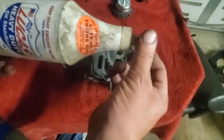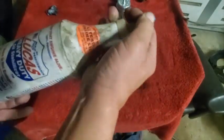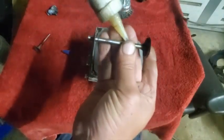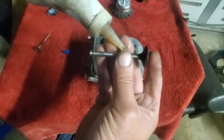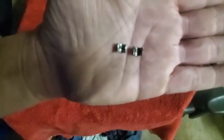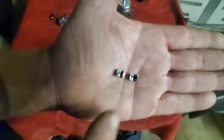I'll be putting the valves back in and show you how to do this without any special spring compression tools. Get some of this thick Lucas oil on the valve stems before putting them down in the guides. And there are the keepers — they're kind of tapered, skinnier on the bottom than on the top, and you've got those little grooves in there that hang on to the top of the valve stem.